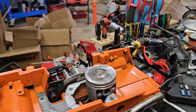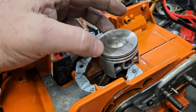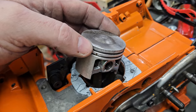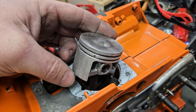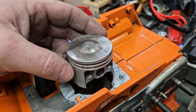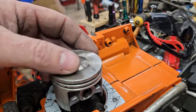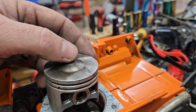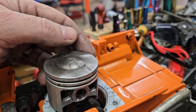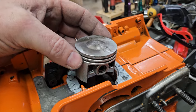So let me show you what we got. This is a 028 Super Piston. I imagine there will be a few people in the competition using this setup. It's got quite a taller dome on it — a taller piston with a shorter skirt, which means you have to do less intake work. The taller piston really helps out for guys that can't machine, to get more compression. I am fully aware that this dome, this pop-up, might touch my spark plug — if it does, I'll just take a little off the top. I am running a base gasket because this piston is taller and you don't have to get rid of the base gasket.